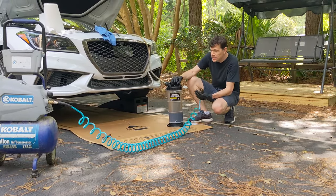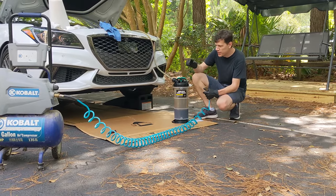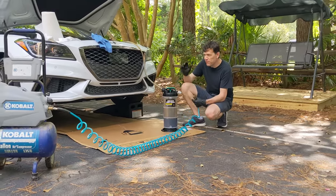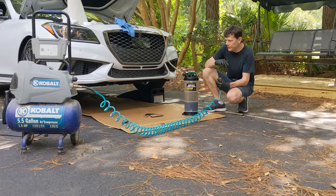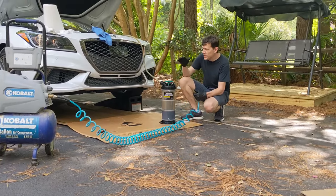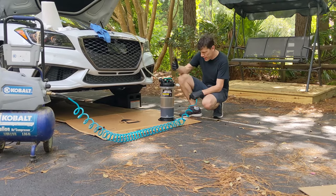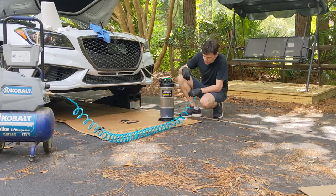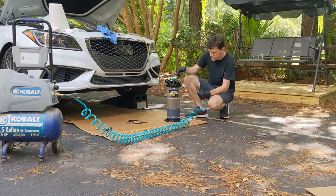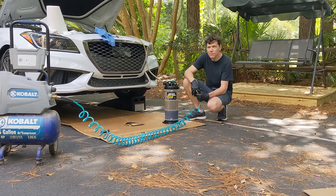How many years you'll get out of this is hard to say, but it's definitely decent quality for about $110. The hose is heavy duty, all the fittings seem pretty good, but overall it is plastic construction. With oil under pressure I wouldn't trust it if you just flip the valve open and use it hardcore — you want to be careful. You don't want oil exploding all over the place. But all in all, for a little over a hundred dollars this will make your life so easy. A couple of different sizes are available online; you can get the no-name Harbor Freight brand too. High quality hoses, decent fittings, good valve. If you want to change your own oil in the driveway without jacking the car up, this will make your life pretty easy.